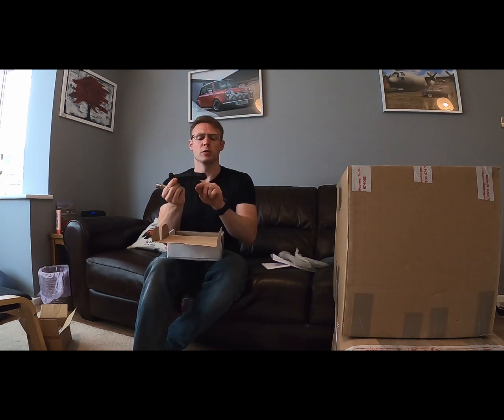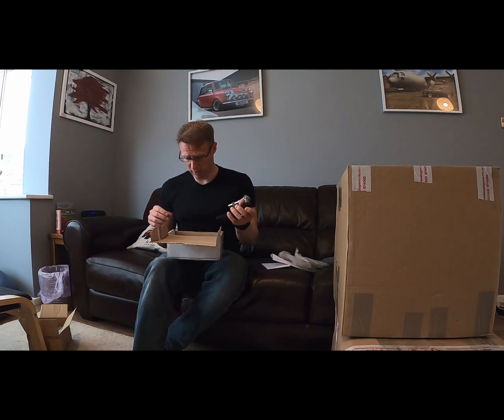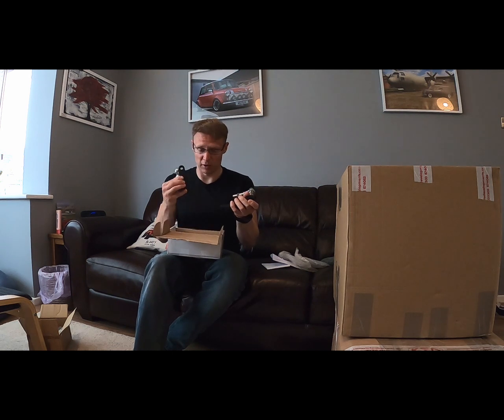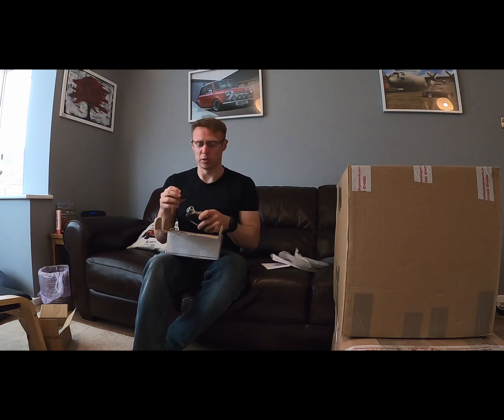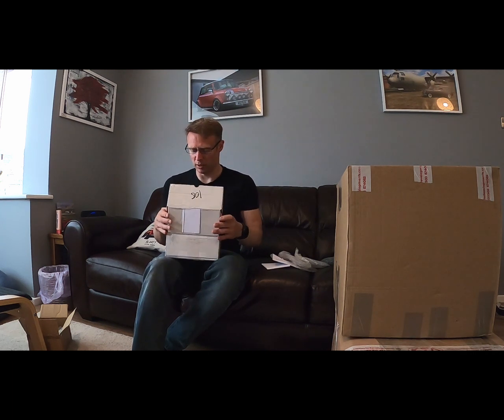On the ERA, what they do is they put a 10mm block under this and space it up, actually above the hub. But the way the guys at Mondo Sport have done it is they found this is the better way of doing it. So they'll go onto the hubs. And once again, there's two of those. I haven't just bought one side. And I've also bought the rubber gaiters because typically with the rose joints being where they are, they're going to get covered in crap. So I've bought a set of rubber boots, so they'll go over. I'm sure I'll wrestle with them at some point in the future, so they can go on as well.